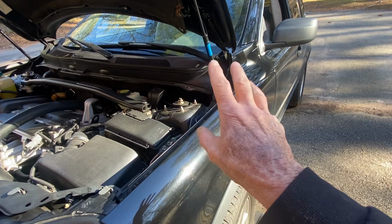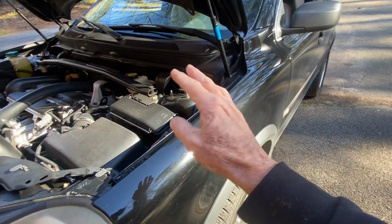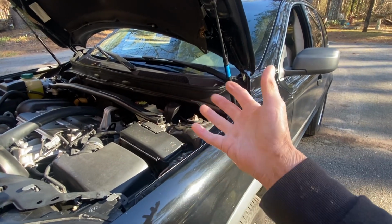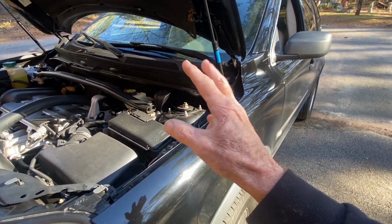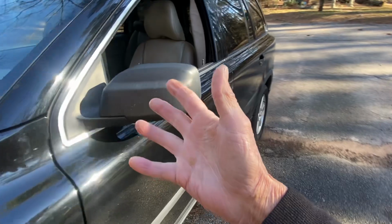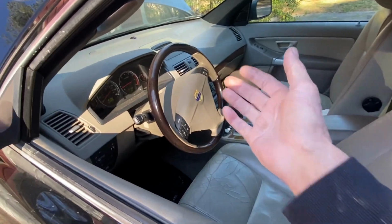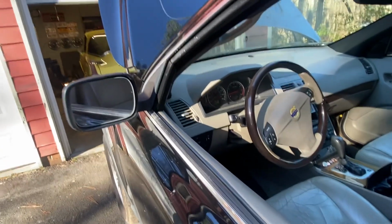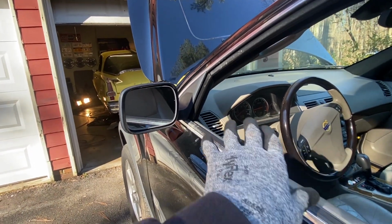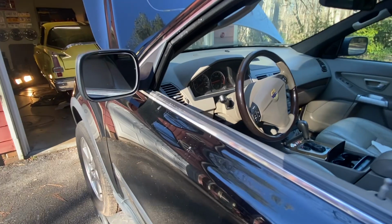Initially, my thermometer, or my temp gauge, was like not working at all. My heater wasn't heating up. I wasn't getting any warm air, and in the winter, that's kind of a suck deal because I was going to work every morning driving 30 to 40 miles one way, and the car was still cold when I got there. So what we have been doing, and like I said, this is a multiple thing, elevating the car up to try to move everything up to the highest point in the way of any air that's trapped in the engine.